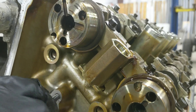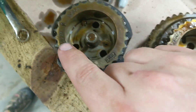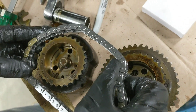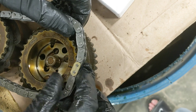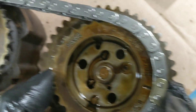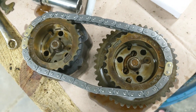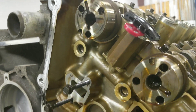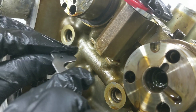Here's the back of the driver's side sprockets. There's a mark here and a mark there - those should be in line with each other and opposing. The new kit comes with a chain that has two marked links and one single marked link. On one sprocket you straddle the double mark - splitting it right in half - and on the other sprocket the single mark goes between those two links. It's set up this way because the chain has an odd number of links. Install the new secondary tensioners - the kit includes a new body, a new clip for the bottom, and a new bottom guide.